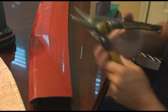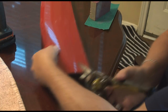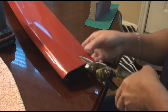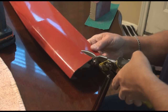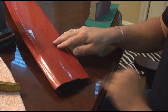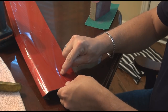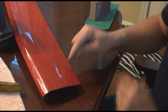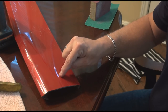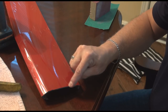Next, what I'm going to do to make it simple, we're going to take and cut this. We're going to leave it about like that. And then what I'm going to do is drill a hole here. This is just to show you that you can stop-drill the crack if it goes in, but we're also going to fill the hole with new plastic material as well, and then we're going to work our way back and fill the crack.